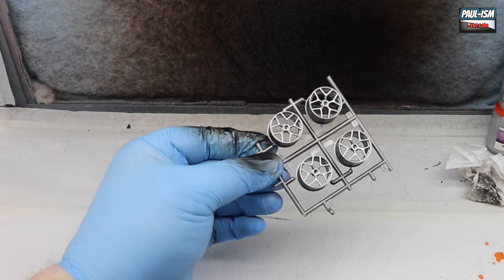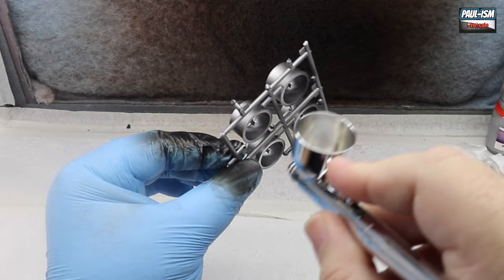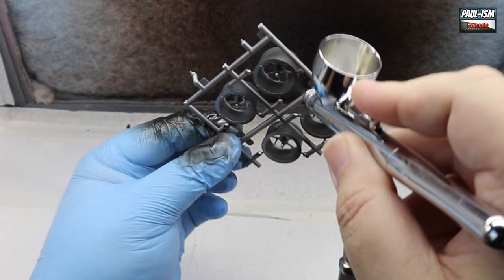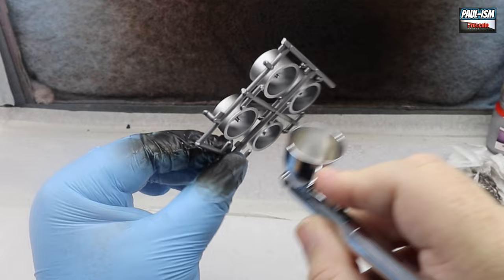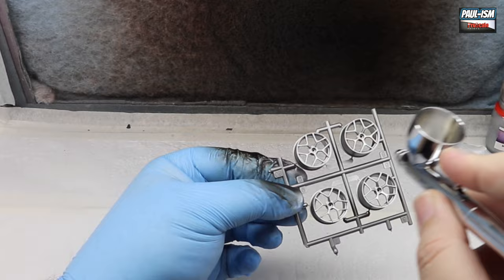A couple of coats on top and underneath to get inside the wheel as well. We do circular patterns to begin with from the outside in, then I'll angle the wheel to get in all the sides of the spokes. You need to be pretty critical here in getting all the angles properly. I'm spraying very, very little paint through the airbrush, just making sure we get nice even coverage everywhere, spraying all four angles to get all the spokes nice and even.